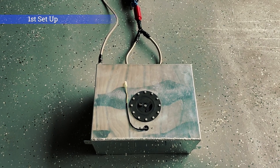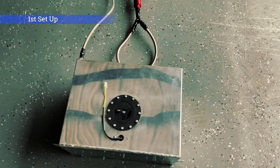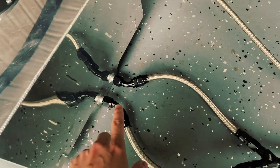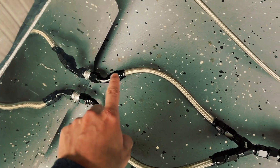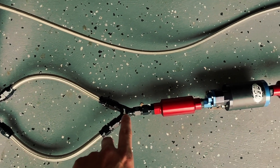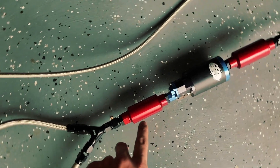Here's the first setup for the fuel system. You have the fuel cell. The fuel cell is going to have two outlets. You don't have to use both outlets — you can use one, but if you use one, go ahead and plug up the other. So I got two outlets coming out into a splitter. From the splitter, go into the fuel filter.